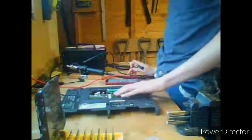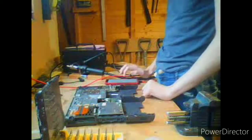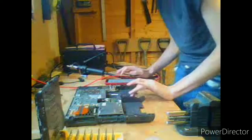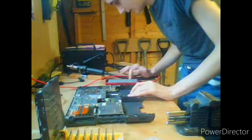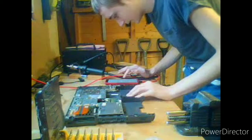Yeah, something about the service tag. The service tag on this has been rubbed off, so no big deal. I just used the tag that came with this motherboard. It's locked to the BIOS, so only the BIOS on this computer, or on this motherboard, will hold the service tag. Now, when I've dealt with this machine, I'll add a sticky thing on the bottom to sort that out. Microprocessor module, all the fan stuff is dealt with.